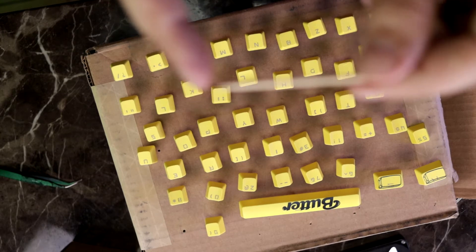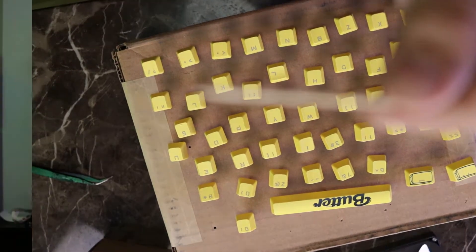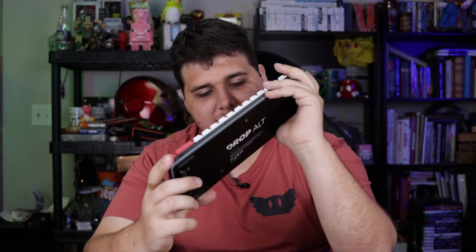Actually, the Razer ones are porous intentionally, but on the cheap ones it's not intentional. When I first built the butter keyboard, the keycaps sounded like Legos when they hit the ground — a very specific sound that I was like, that's not okay. As opposed to the Artifice Red Velvet Bloom, which are much nicer keycaps. But I wanted the yellow. So by doing a quick paint mod — just a layer of matte clear coat — you can actually make the keycap feel better to the touch after it's dried.